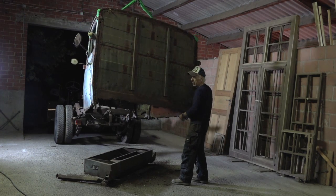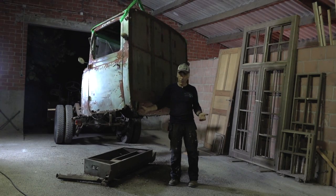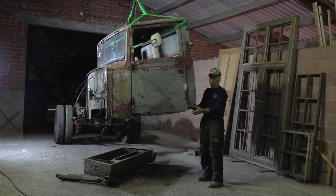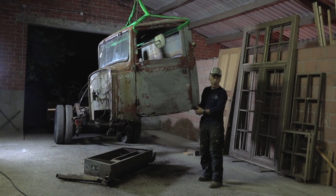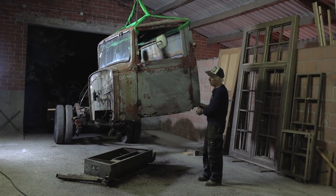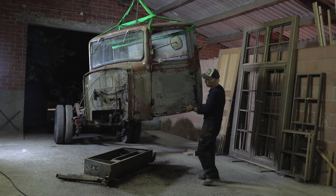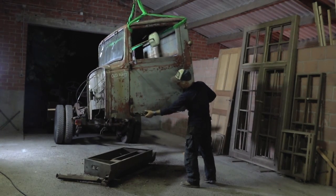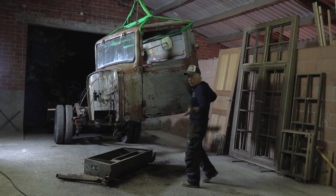The sills are completely gone - the inner sill, the outer sill, gone completely. So we have to re-weld them. The support points here - I don't even know where they are, they were gone already when I took it apart. But the good thing is the doors themselves are recoverable, so we can rebuild that. In fact, we will rebuild the whole thing.